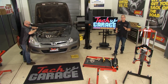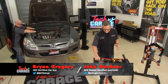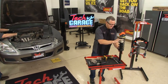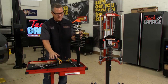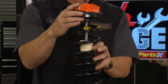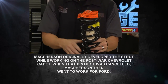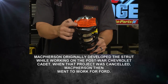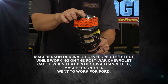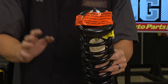Welcome back to Tech Garage, presented by Advance Auto Parts. Brian's working hard on the quick strut assembly. What is the quick strut assembly? It's the whole deal — you're getting the spring instead of just the strut, it controls ride height, and it includes a new rotator plate. But there's an important piece: it says don't remove that top nut. Please don't remove that top nut. This spring is under an immense amount of compression and could do some serious damage.